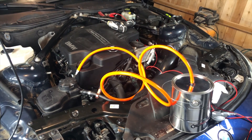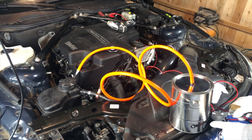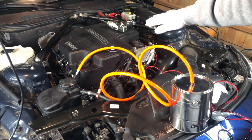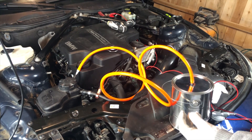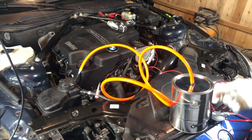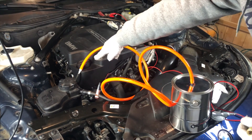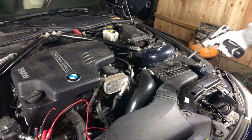I have my compressor over there — you plug this in and it controls the pressure, so it's going to come out at one PSI, which is the maximum safe pressure that the engine's vacuum lines and air lines can handle. The smoke is going to be created by connecting these wires to a battery, which generates the smoke, and with the pressure it's pushed out of this hose, which we've already plugged into a vacuum line. We're going to start by removing the air filter box.